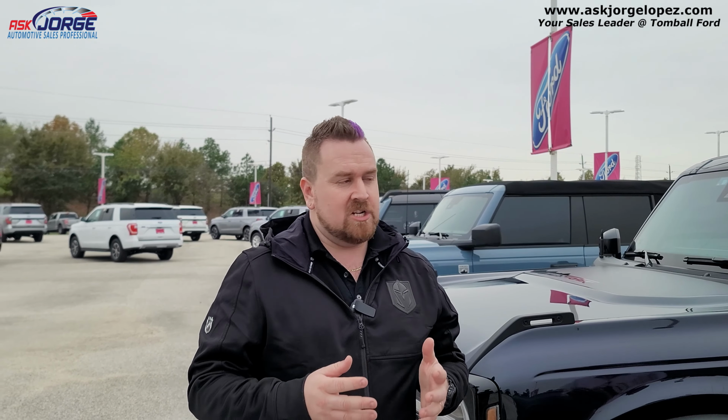So ride quality is not really gonna change much when it goes to a bigger tire. What's gonna change on ride quality is how aggressive the tire is. So the more aggressive the tire, if you jump up to like a mud tire, there's all terrain, you have hybrid tires, you have mud tires. Jumping up in the mud tire series is gonna give it more road noise, like the humming noise that a lot of people hear going down the road. And we try to eliminate a lot of those sounds. So we recommend doing a hybrid tire that looks aggressive, but it's quiet going down the road and will get you maximum tread life as well.